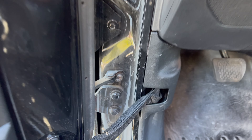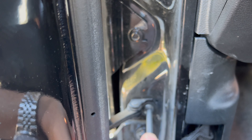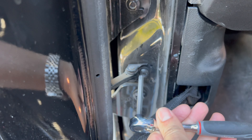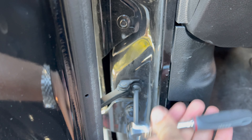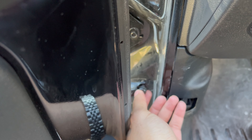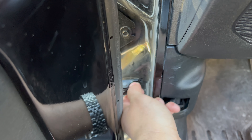You're going to see the T40 screw right here — there's going to be one on each of the doors. Take your T40 socket and undo this. Once you've completely loosened the door hinge screw it's going to pop off. Put it inside your door handle to keep it simple.